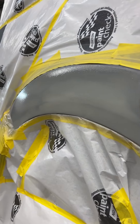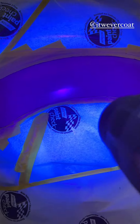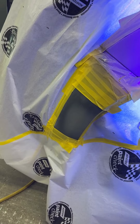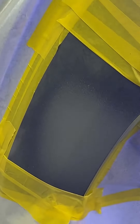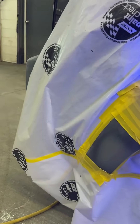I don't know about high build — I don't think the 1.8 tip is quite big enough, might have to go to Princess Auto and get a 2.0. This is a bit of a trip using UV primer — I can see it drying in real time with just a light. I'm doing a free repair for two reasons: I want to try it on plastic to see if it blows up, and second it's a color blend I just did around the bumper — perfect color match, deals with the scratches, everybody's happy.